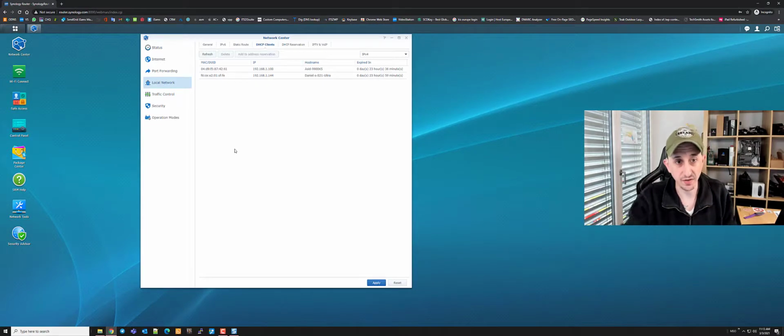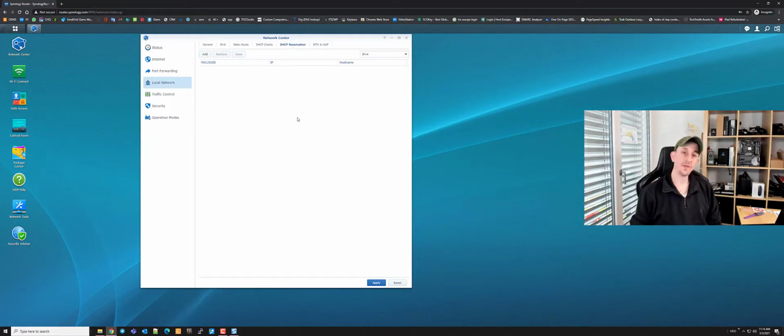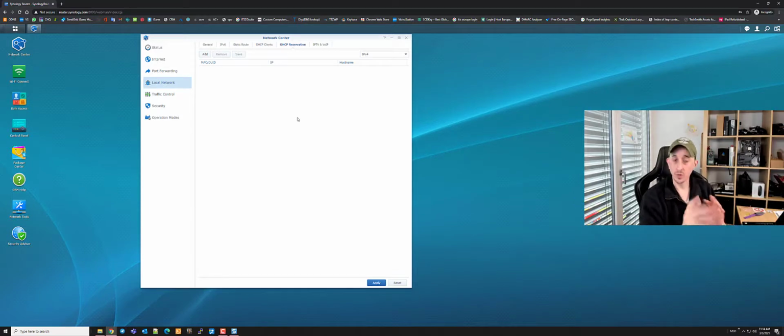Cool, so you get the idea. And you see 144. DHCP reservation. This is when you have something like a service, you do some gaming on your computer, you need ports to be forwarded to your computer when your portable computer is within your wireless network, within your local wireless area network. But you don't want to have to manually change your settings every single time, because you might take your laptop out of your home and connect to someone else's wireless network, and you want it to be able to just pick up an IP automatically.